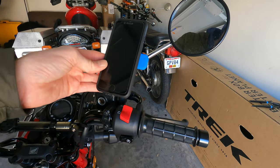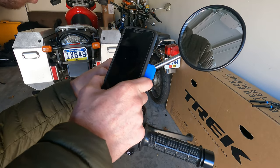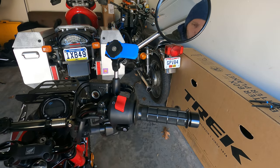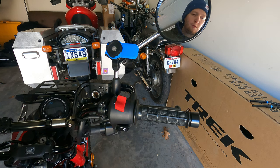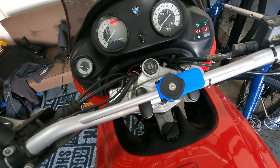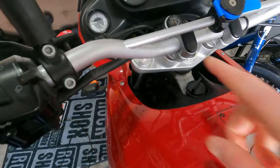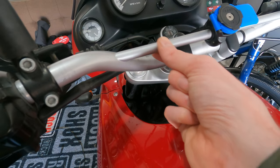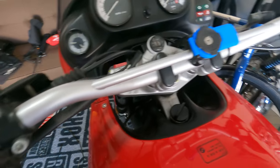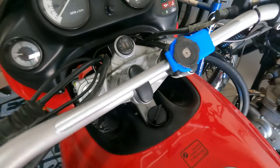There's some play — I'm not sure if it's supposed to have that much or if I just knocked it loose somehow. Let me show you what it looks like on the BMW and how I did it there, because I used the same scooter motorcycle mirror mount but it mounted to my handlebars. Here's our setup on the BMW. You can see the BMW has this weird crossbar across the handlebars — I took digital calipers and measured, and it's actually the same diameter as the mirror on the trail. So I thought this was a really good way to save a little bit of money and have a really clean mounting system.